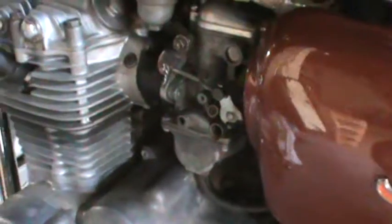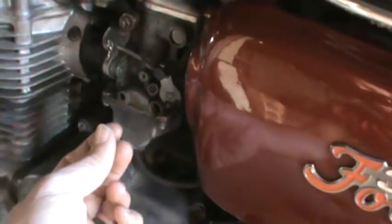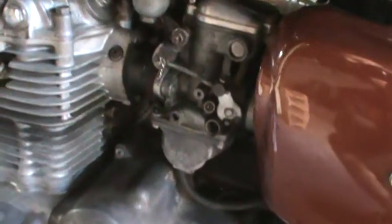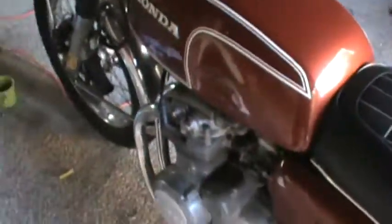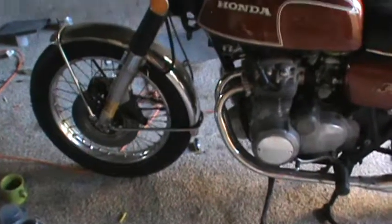Turn the gas back off. This bike, the needle valves for the floats probably could stand to be replaced. I went up to get gas a while ago, and if you don't turn the petcock off when the engine's not running, they're just not seating really well in the bowls, so it's puking some gas out. But that's easily fixed. Probably 10 or 15 bucks in the new needle valve seats. Or ride it like it is and just remember to turn the petcock off. No big deal.